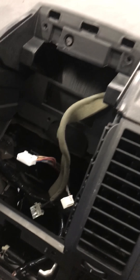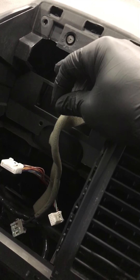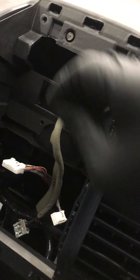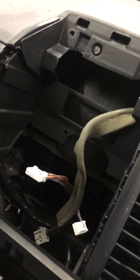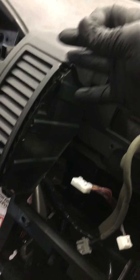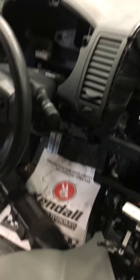The blower motor itself is dead center below here. The final step is taking the blower motor out with an 8mm screw and turning it one inch to the left. The BCM is still in the way, but that's just hooked down to the bracket, so you move it to pass the motor out and clear the bracket.